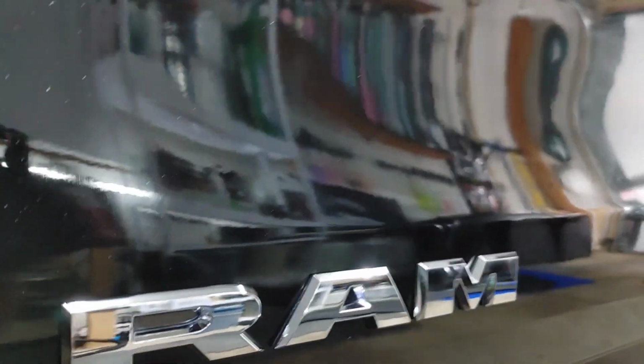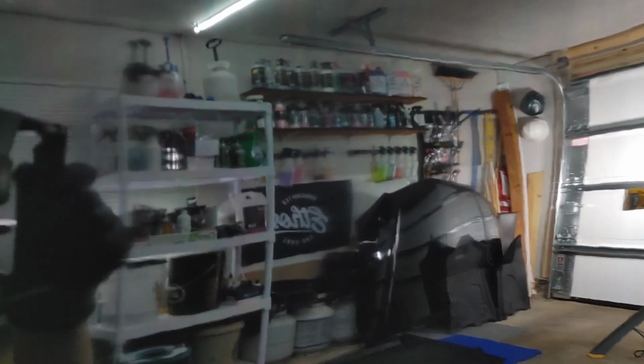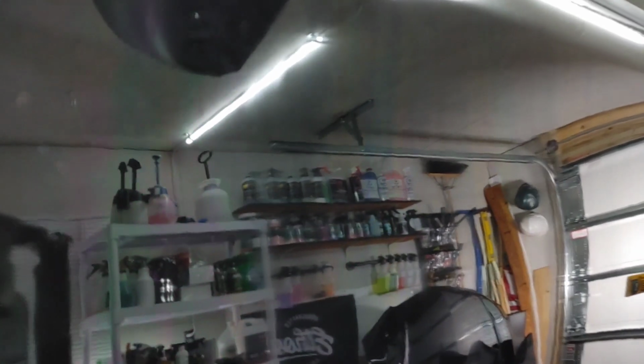A lot of coatings, that's your telltale time to buff off. But with this coating, we're going to let it sit as recommended for the 10 minutes. Doesn't mean that it's difficult. It is a little grabby to remove. It's very similar to what you would encounter with a graphene coating. You can just see this is our rainbow effect going on. So we're just going to keep moving panel by panel, get this applied, and then at our 10-minute mark, we will start removing.